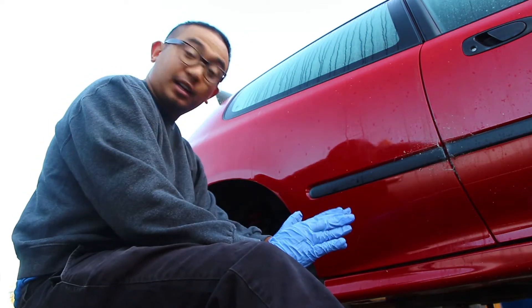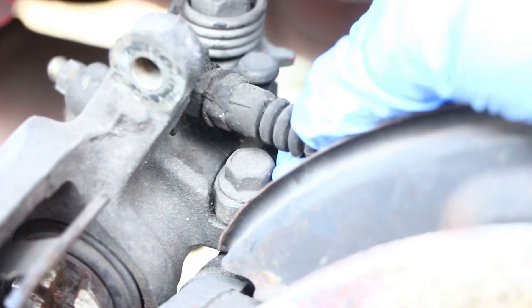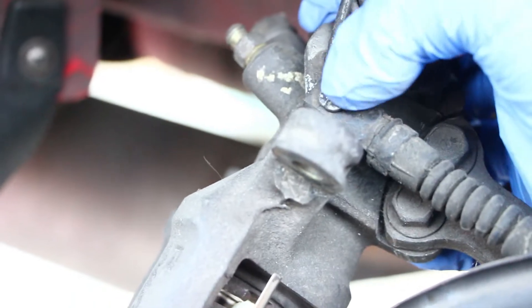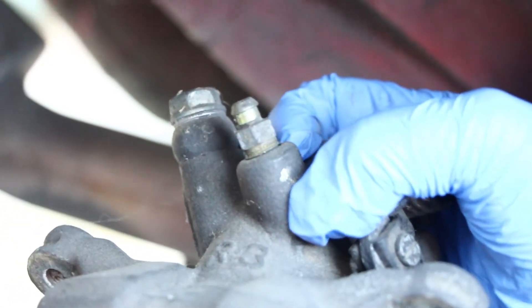Let's remove the emergency brake line. There's this brake line right here you have to remove. In order to remove it, you have to first remove the pin - I think it's called the cotter pin - that's holding this. It's gonna be in the back right here - it's hard to do this with one hand, but yeah it's like right there.